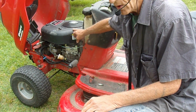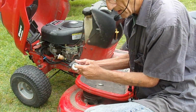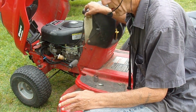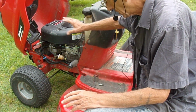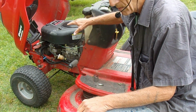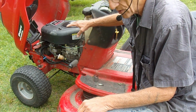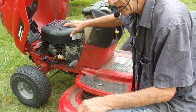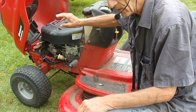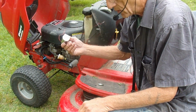And that's possible with the first valve that had the screw in the center. But the one with the screw in the center, I couldn't keep it tight. But now the other lawnmower that I do have, all this is put together the same way, and it hasn't failed on me. But I did do a temperature check. Yesterday I cut with it for like 5 hours, and I got about 218 degrees at the valve cover. So I kind of figured that would be a stable temperature for the engine, and it may exceed what this is allowed. I'm not sure.